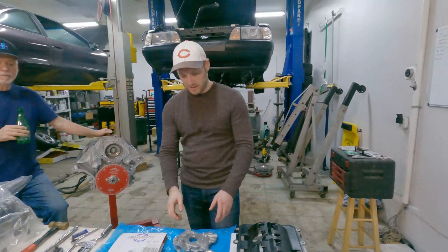All right, so this backing plate — it's kind of difficult to find a torque spec for these things. I'm seeing 89 inch-pounds, I'm seeing 94 inch-pounds. I'm going to do 100 inch-pounds. There's really not that much torque and I really don't want this to come apart. Comment in the comments if you know the answer. Probably need a little help here. Okay, cool — ready to go on.